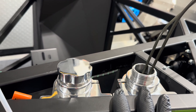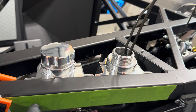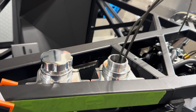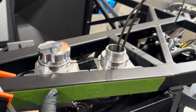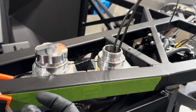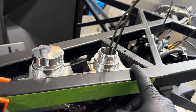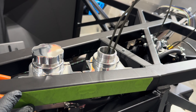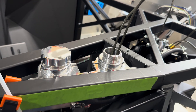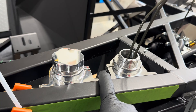How did I mount them? I thought about the L bracket and about just drilling straight through the frame with nylocks on the outside, but I didn't really like the look of that. Ultimately I ended up using a step bit and drilled holes on this side of the frame just large enough to fit a 7/16ths socket through to tighten the nylocks on the backside — they're basically internal to the frame now. I've got four holes here and I may put a metal plate over this, maybe rivet it in place so I can drill them out if I need to remove it. It looks pretty clean from the other side or from the engine compartment.